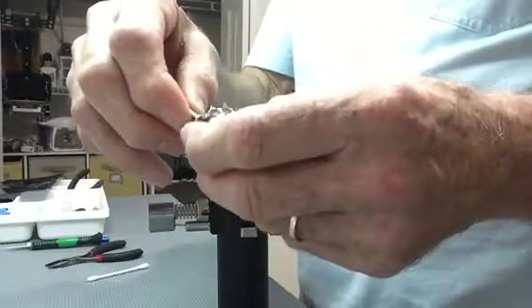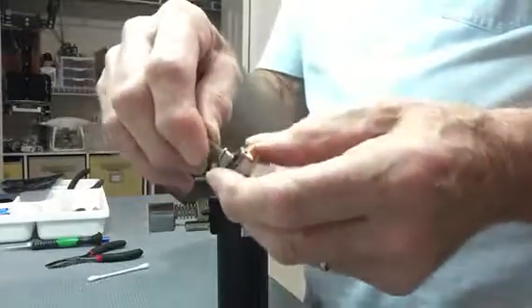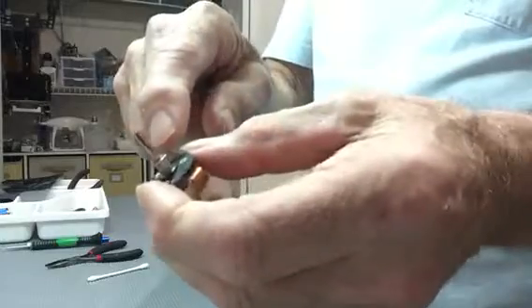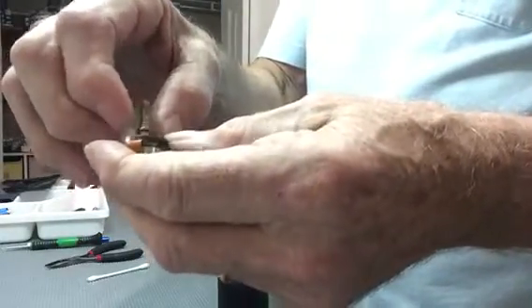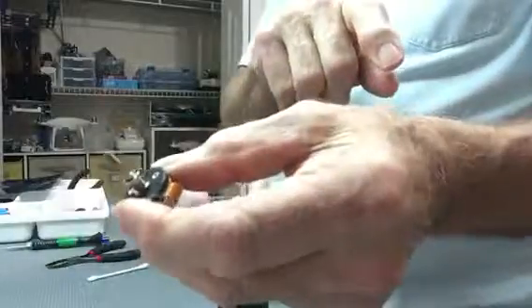After a crash, the magnet gets thrown out of whack and can't be recalibrated, so you have to free the magnet off the shaft so you can turn it. First, you mark the magnet so you know exactly where it is in relationship to the flat spot. I put a black marker mark centered on the flat spot on the yaw motor so I know exactly where I started.